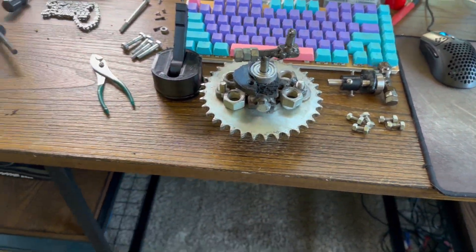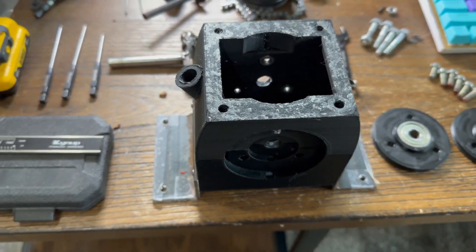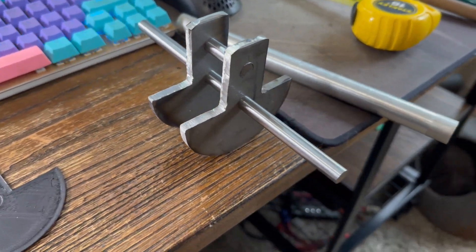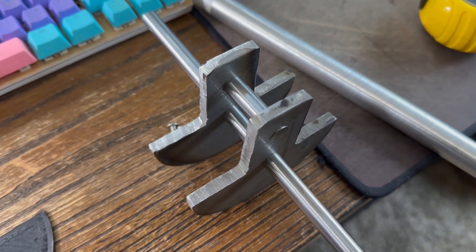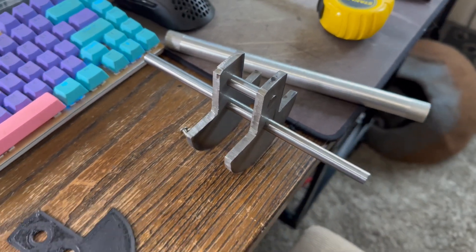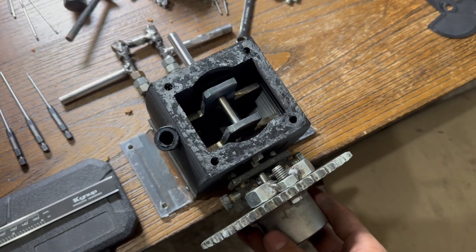I'll come back when I start working on all the upgrades. I've got the new crank case printed — I put an oil fill in there instead of the intake hole for the two-stroke. The bearing holders are done, and here's the crankshaft template. This is very similar to Camden Bowen's design — basically upsized with a 26-millimeter throw on each side, giving a 52-millimeter stroke, which makes this 180cc's. I designed it in TinkerCAD, printed it out, and I'm going to go weld everything up.